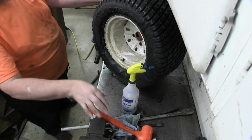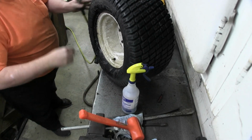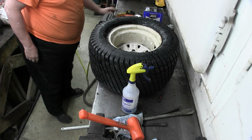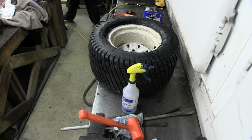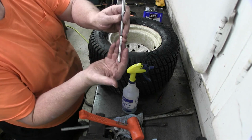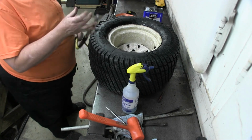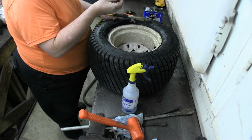Put some air up on it there. We're almost on it there. Not quite there yet. There's one pop. Okay. Let it sit for a minute. These tires run such low pressure, you have to have a special gauge for it. This gauge goes to 20 pounds, no more. Yeah, see, I'm just shy of the pressure I'm supposed to be running. These things don't take much to keep the pressure. Yeah, I'm 1 pound over.